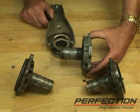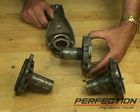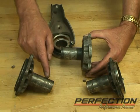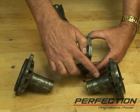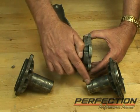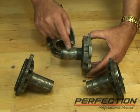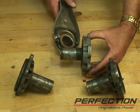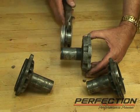Now we've got 3 examples of worn out guide tubes or front bearing retainers. Here we've got damage on this one. In this case it looks like the bearing might have spun on there finally. This one's got some deep scratches in it, some gouging out here. This one has the classic wear pattern. The bearing moves in an arc from the fork.